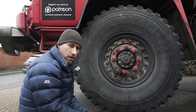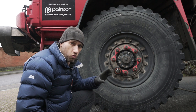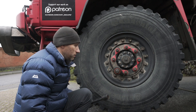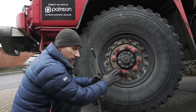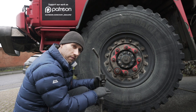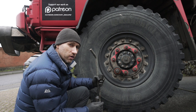Going back to the torque wrench — around three to four hundred pounds, heavy and big — I know many people won't have one with them. I do recommend it: get a torque wrench and do your nuts up properly. But if you don't, another option is to use a wheel brace: do the nut up as tight as you can with the bar, then put the torque multiplier on and do two revolutions of the handle, which is about one-tenth of a turn on the nut. From experience cross-checking with a torque wrench, I know that's about right — but we're all different; I'm about 85–90 kilos, you might be 60 or 110 kilos, so you'll get a different result.